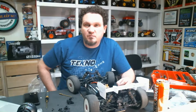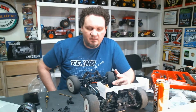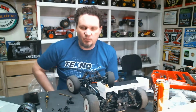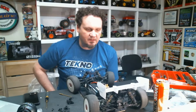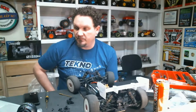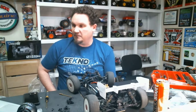And then I actually went to 100%, but I put the coast feature on Hobbywing. I moved it up to, I think, 10. And that made a huge difference on this car. I was blowing corners all over the place. And when I gave myself 100% brake and then used the coast function in there, it kind of acts like a drag brake, but not really. I was able to drive a lot harder, a lot faster, and a lot smoother. So I am pretty happy so far. I just got to get it fixed now.